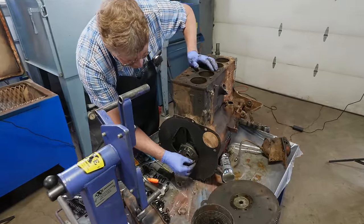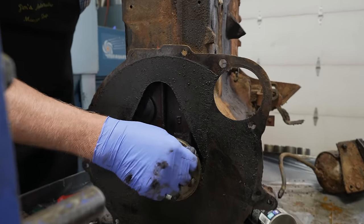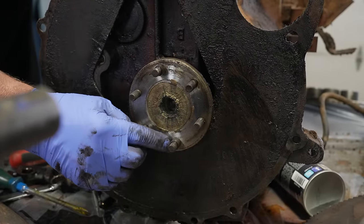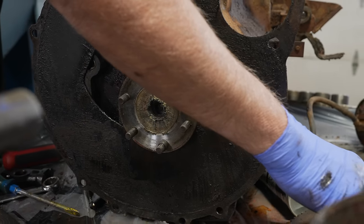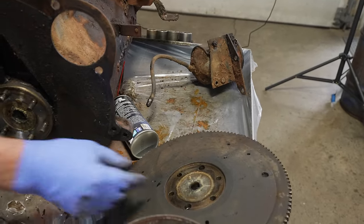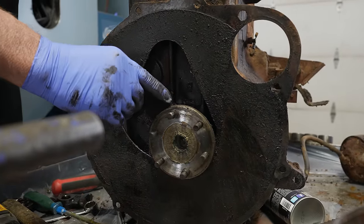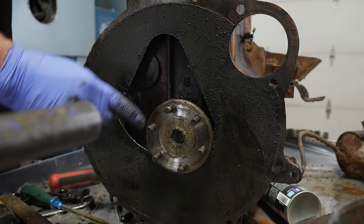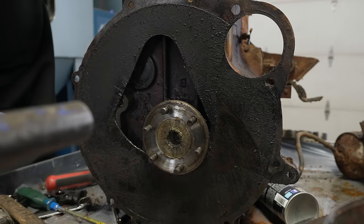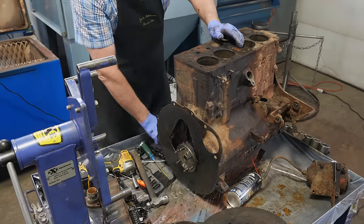There are four of these that are basically just bolts into the flange of the crankshaft, and two of these have little tapers on them that go into holes on the flywheel so it can really only be put on in one position. One of the things you always have to remember is to make sure you put those bolts back in the flange of that crankshaft before you put the crankshaft in the engine, or you may end up having to take it back out and do it over. And this plate should just pop right off there.